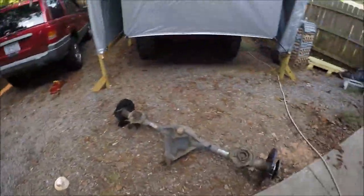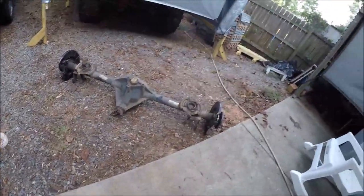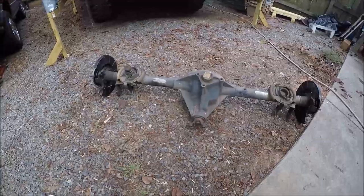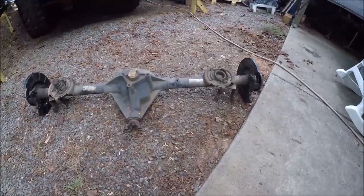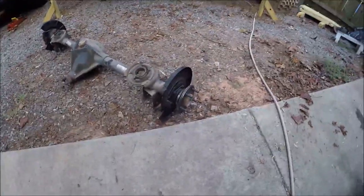What we're going to do is talk a little bit about the axle I pulled out, to give you guys an idea of how an axle works and some of the nomenclature if you've never dealt with rear ends before. So this is your basic solid axle — it's a Dana 35 like I mentioned earlier. It is one of Jeep's worst axles that they ever chose — it has weak axle tubes and it is C-clipped. This is also what's referred to as a semi-float axle.